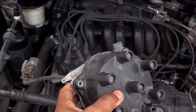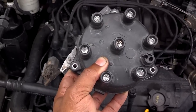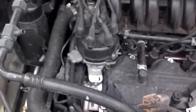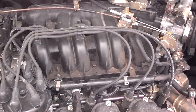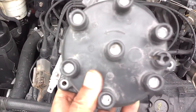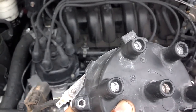I was going to attempt to replace this with one from the salvage yard; however, this one is out of a 98 vehicle and the 99 vehicle is different. They also have a different color intake manifold — that's kind of a clue. Just take a close look at it and make sure they have the same connections before you go pulling one from the salvage yard.